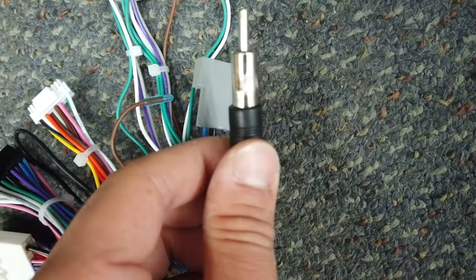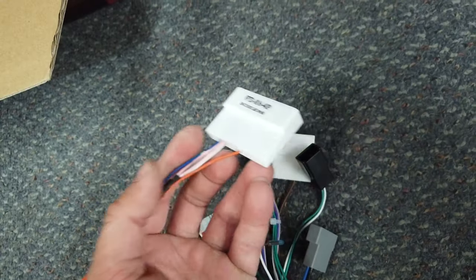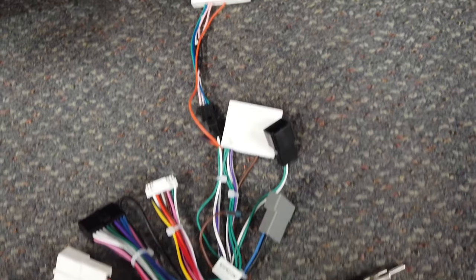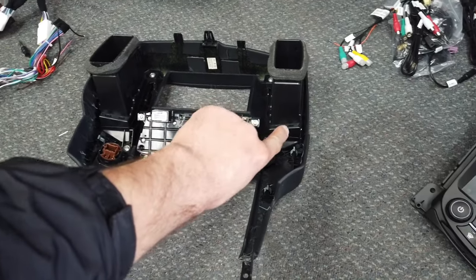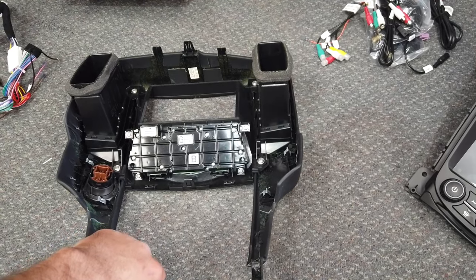This is the radio antenna — the factory radio antenna. If your model is a 2009 US model you'll need to use this extender instead, and this goes to the back of the head unit on a 2009 370Z model in the US. And finally we have the audio box — this is essentially a ground loop isolator. Let's go ahead and remove the air vents and the keypad and put her down face down onto the unit.